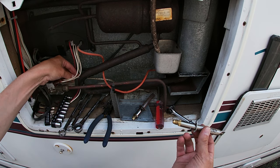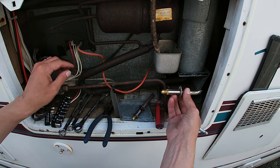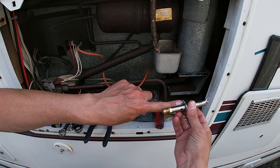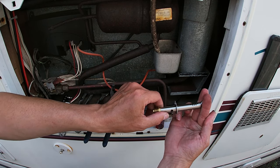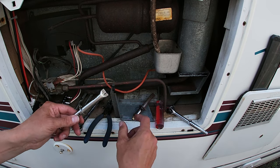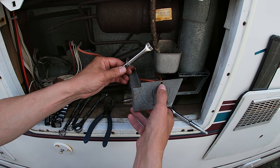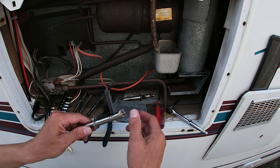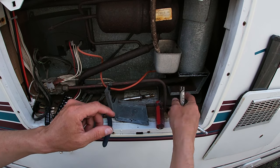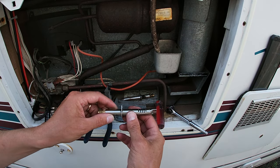All I did was take the line off here. There's a single screw that holds this in, and it's slotted into the steel on the other side — very easy to take out and put in. There's a dust cover here that shields the entire thing, one screw to take that off. We're going to put this all back together, and then I'm going to put the GoPro in there and actually show you how that flame comes up into the tube.